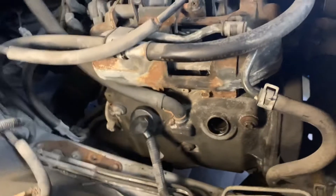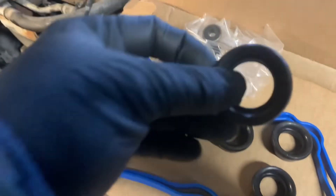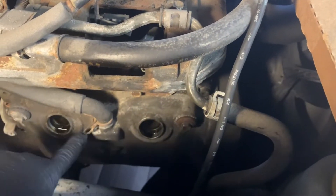If you go to change your spark plugs and you pull up the spark plug tube wires and they're covered in oil, it's likely the tube seals — spark plug tube seals — which are these guys, which sit in between the valve cover and the tube itself.